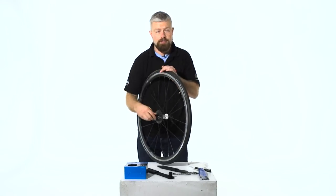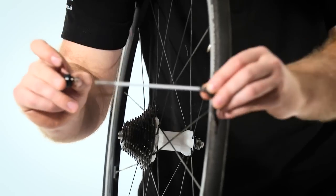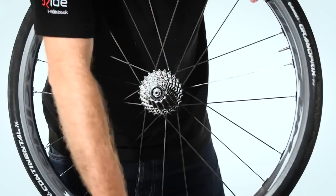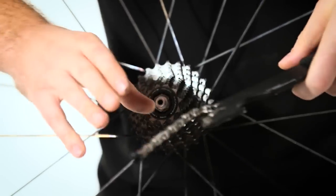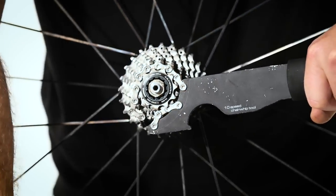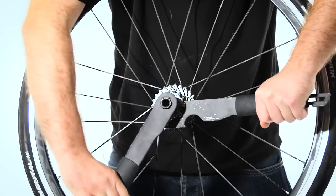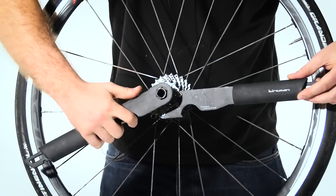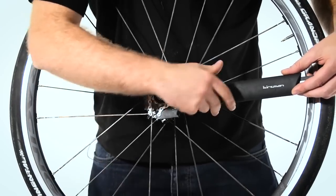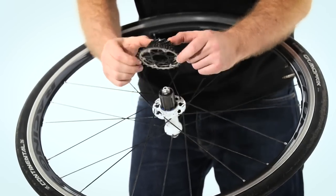With the wheel out of the bike, we're ready to remove the cassette. Undo the nut from the end of the quick release, making sure you've got the small spring as well — there's a spring on the other end too. Just nip the nut back on so it's all safe. To remove the cassette we're going to need a chain whip, which holds the cassette stationary and stops it from freewheeling. Wrap the chain around one of the smaller sprockets, grab your HG lock ring tool, and push it down, undoing the lock ring in an anti-clockwise motion. There's your lock ring, one of the sprockets, and there's the rest of them.